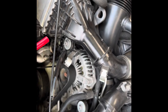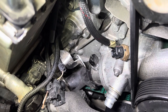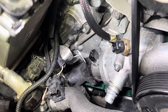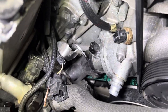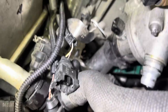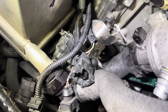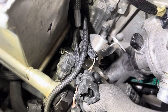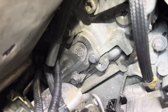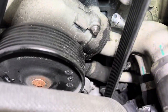After replacing both converters, just a heads up: there's no need to remove the intercooler to access the other bracket bolt. I pretty much bent it out of the way and you can access the secondary pressure converter bolts — you will see studs from the other side once you get in. It's actually pretty pliable so you just bend the bracket out of the way, swap out the pressure converters and vacuum lines, put it back. The bolt is I think T27. Now I've got full access to the radiator hose and I'll start taking the belt and the two pipes off.